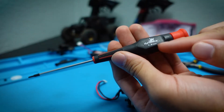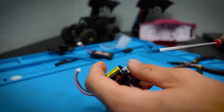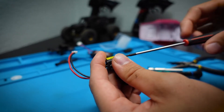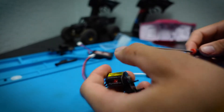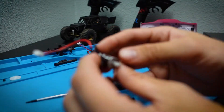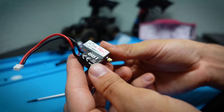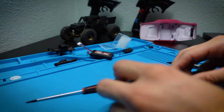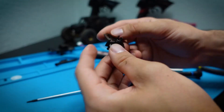There are two more screws holding the motor to the plate — they're 1.5mm screws, compared to the 1.3mm used for basically everything else, so make sure you have both sizes on hand. There is our motor, finally off. The Furitek motor is noticeably longer than the stock one. Setting the old motor aside — we won't need the old pinion — we'll save that in the parts bin.